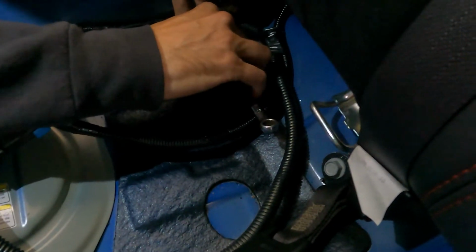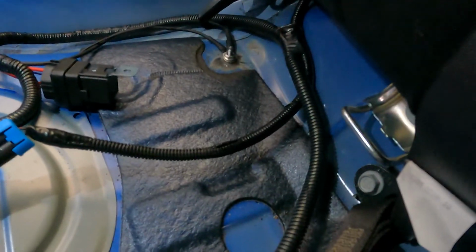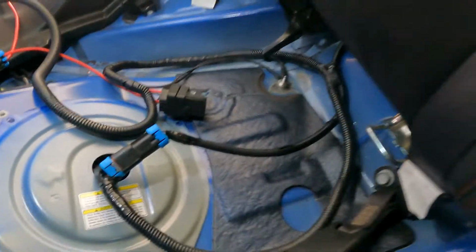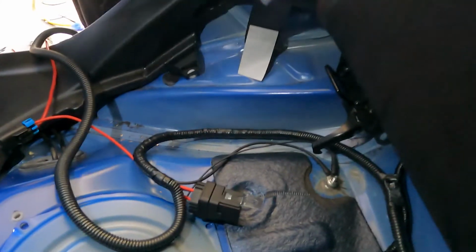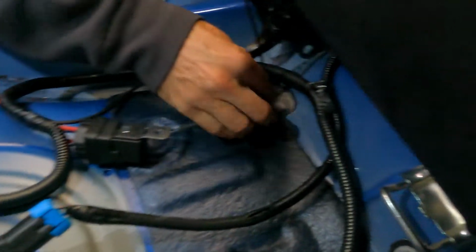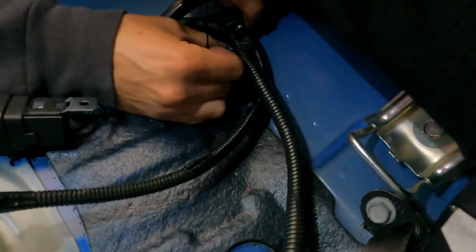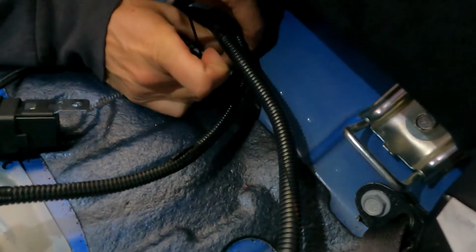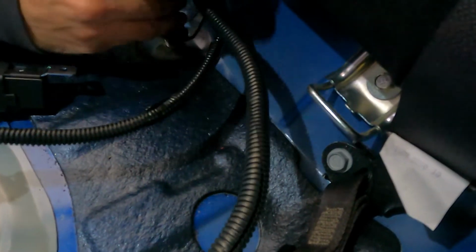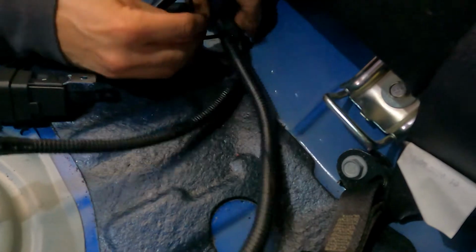Is that the nut you were talking about that you grabbed the first time, and it works? Worked perfect. That's great. And then I found the clip that was originally holding the wiring harness in. I just cut the old zip tie off and ran a new one through it. We can still use it and zip tie our harness back up. Sweet. And it covers just like a little cap for the ground there. Just helps from these wires rattling, you won't hear this. Yeah, and it'll just hold everything in place, there won't be rubbing or anything like that. Perfect.